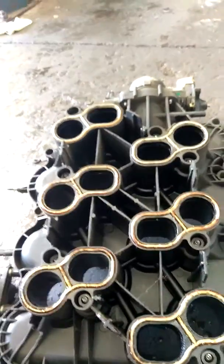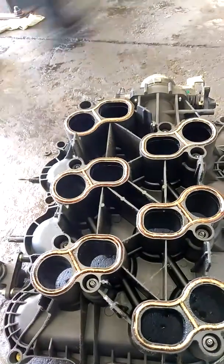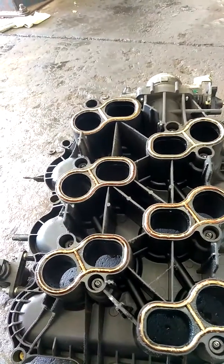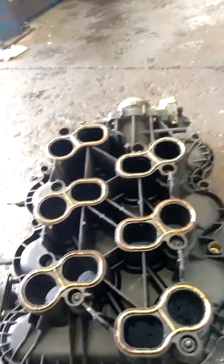I checked the freeze frame data beforehand, and it was 25% maxed out on short terms. And once the engine warmed up, the short terms went to -3s. Just based on my experience, the intake setup here is what caused all that.